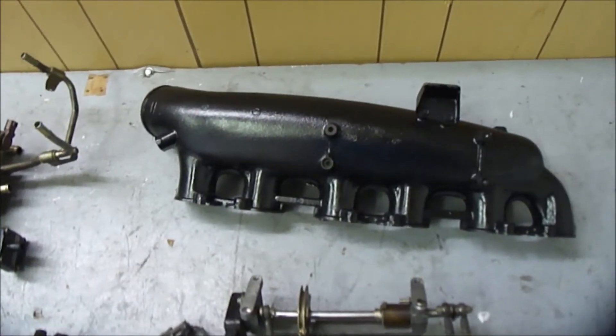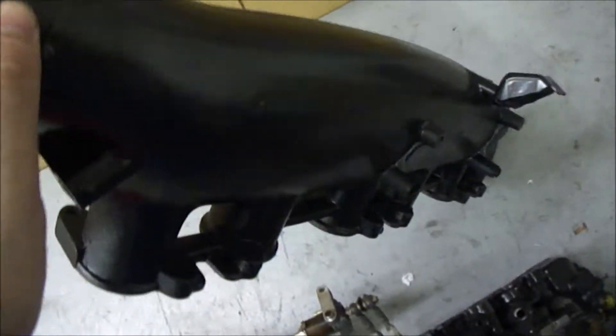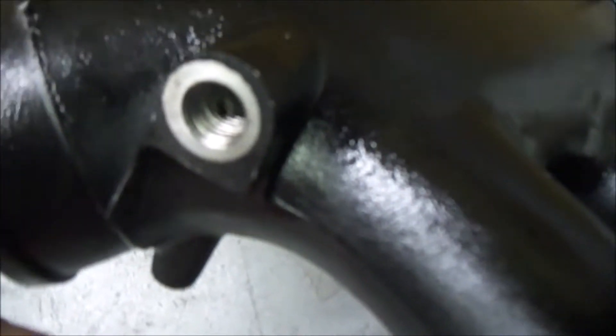The first thing I was going to start out looking at was this. This is obviously the first part of the intake manifold. It has the outer runners and this full piece here. The OEM IAT is located here. Ours was broken, so we're just going to be plugging that off — we have an aftermarket one we're going to use.